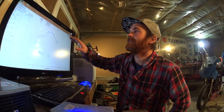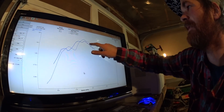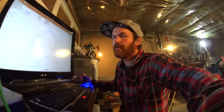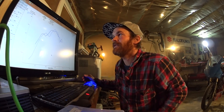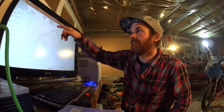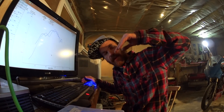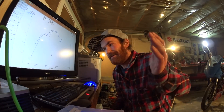It's pretty late so I'll just have to end it here. We did not gain any power — we actually lost a tiny bit up here and gained some here. 1.73 horsepower versus 1.79. I'm guessing if I had done a couple more runs I would have been up to the previous numbers. What I think is the problem is that now that I've raised the barrel, the bad intake timing is even worse, and the piston is now covering even more of the intake port at top dead center. We'll fix that and see what happens.